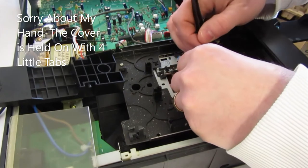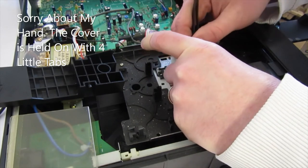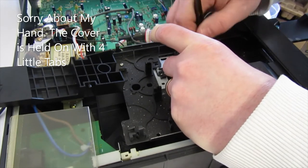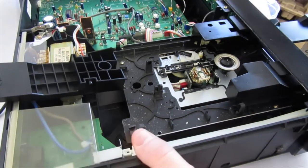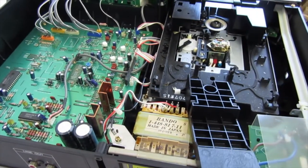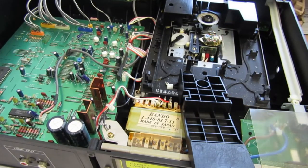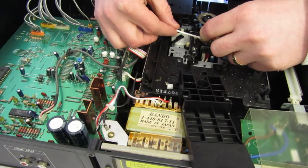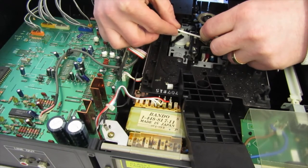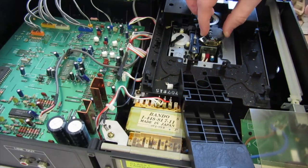What's worth doing as well is to actually clean the laser diode underneath. So you just gently pop off this little cover. Get a Q-tip and flatten it down. Now this is on wires, so you can just gently raise this up, go under, and clean the diode itself. Be very careful because those wires are delicate. And then the rubber just pops back on.